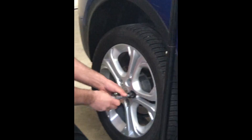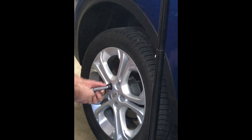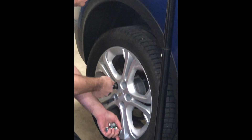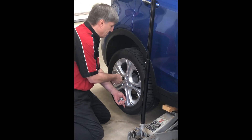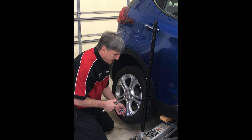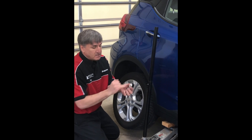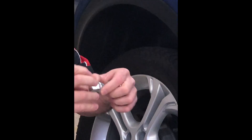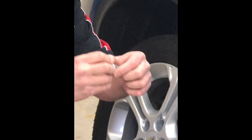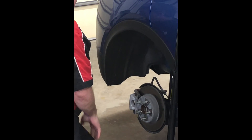But the only thing air tools do is let me do the job faster — it's not better, just faster. This is better; it's more accurate and less damaging. So even for myself at home, I do everything by hand. Part of that is because of this lug nut — some lug nuts have a stamped steel cover over the top. If you use an impact on there, it jars them and over time damages the lug nuts so the covers come off and sockets don't fit properly. At this point I can just take this off.